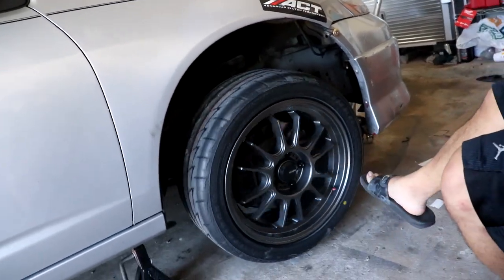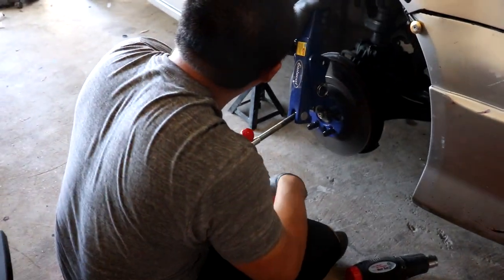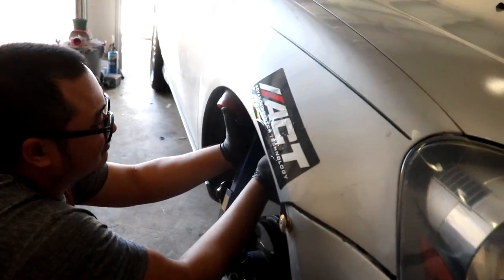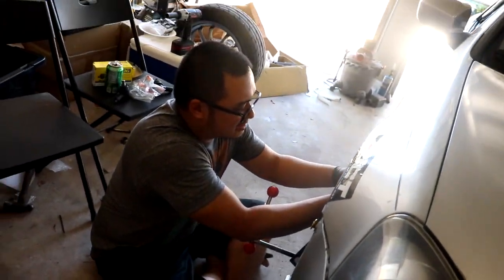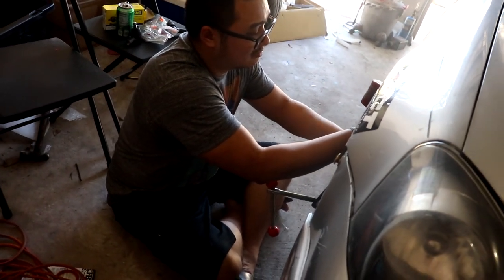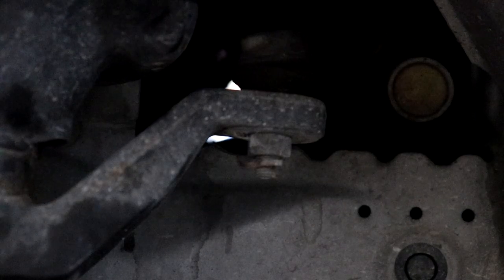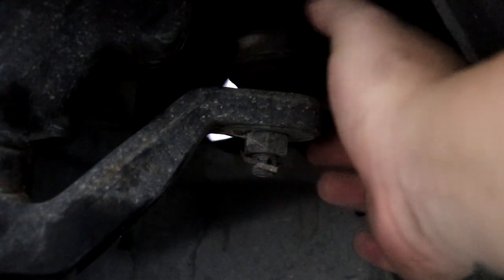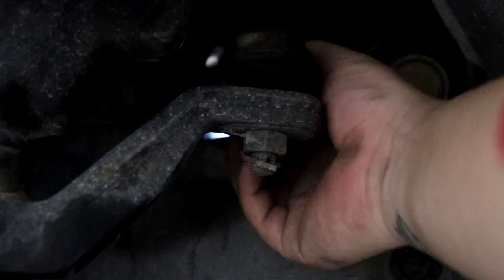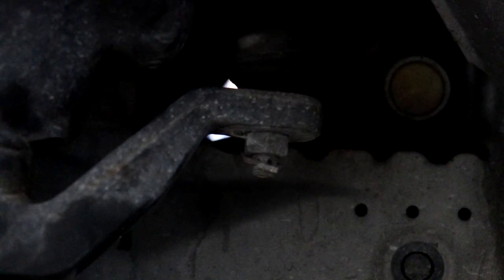So we got the car raised, about to take off the wheels and all that. Steve is starting on this side to start rolling. Luckily, these front fenders are kind of folded in a little bit — I don't know if they were previously rolled or that's just how they were. And then I'm gonna be over on this side to work on this tie rod end. It looks pretty simple — all I gotta do is take out this cotter pin, take out this nut, the end link pops out, and then I think you just unscrew it off. Seems pretty simple, but we'll see. Let's try it out.